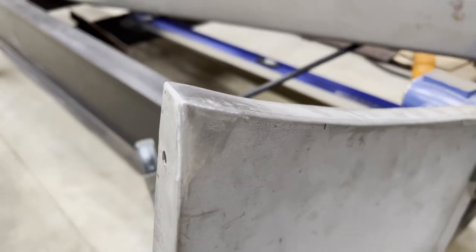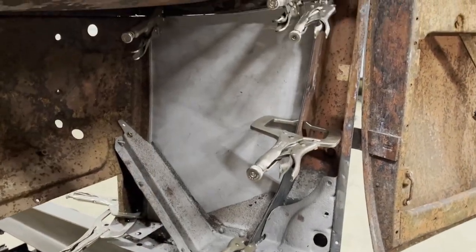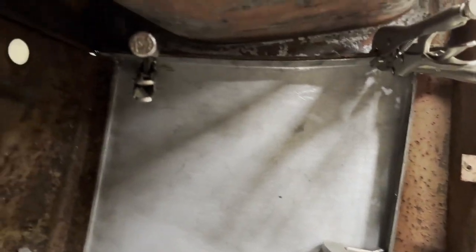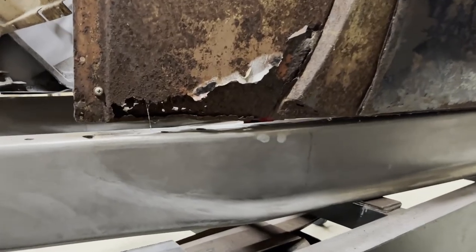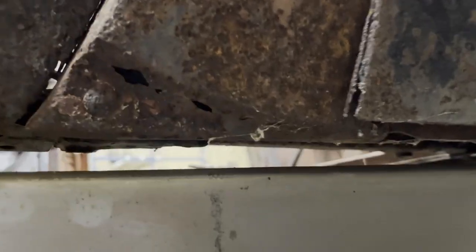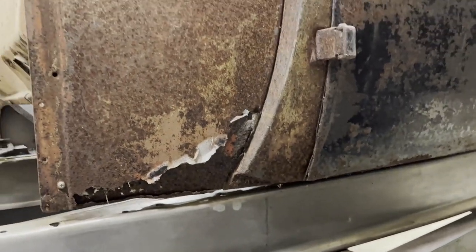I think it's going to fit okay. Let's stick it up there and see. The cowl side's back on, I got the corner done. All the bracing's back on the inside — you can see how it fits inside. I've got to come in here and drill all these holes out all the way around this thing to get it bolted in. Then I've got to start over here — look at that mess. Not as bad as the other side was, but it's pretty bad. Got a lot of rust on this side, just like the other side, though not quite as bad. The lower post on this side is not as rusty as the other side — got a couple of holes under there, but it's nowhere near as bad as what we had on the other side. So this is probably where we'll start next.